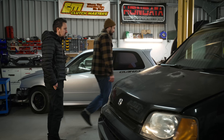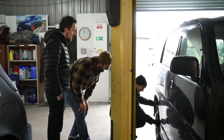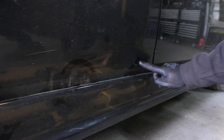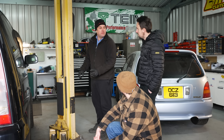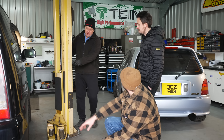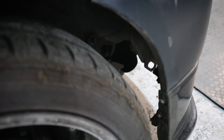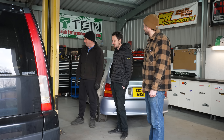This side. Uh-oh. This side's worse. You can see the rust there. That's where the skirts attach on, and there's a hole for the clip. They rust around the clips and then the seals go. That's like the tip of the iceberg - it's worse behind it. I've just noticed the wheel arch liner's missing. Are they easy to get? I've got some, so not too difficult to get. I think that's going to be the least of your issues, though.